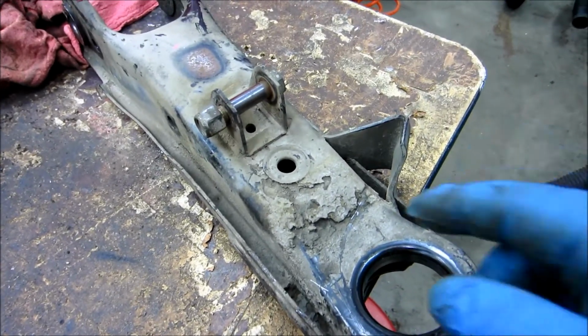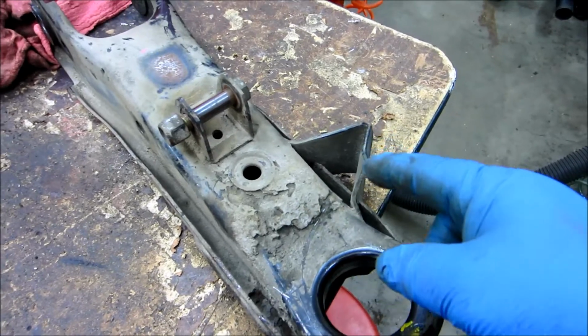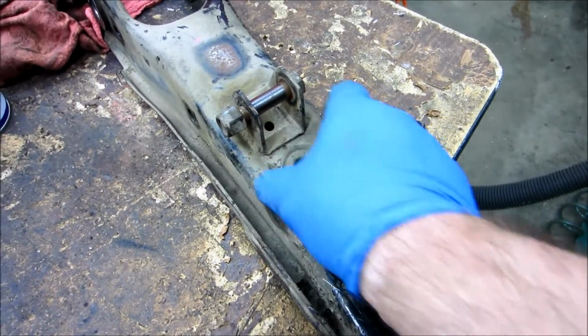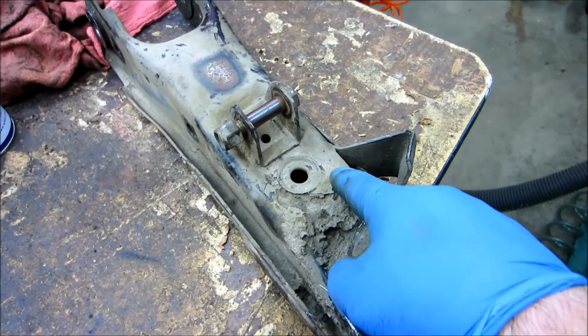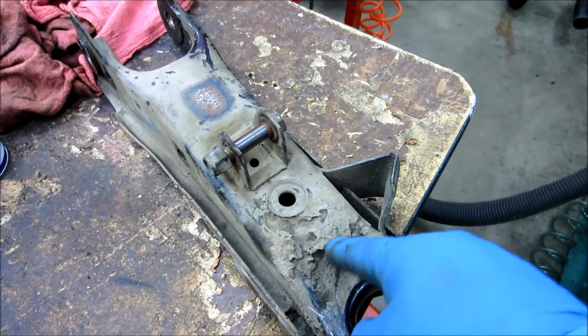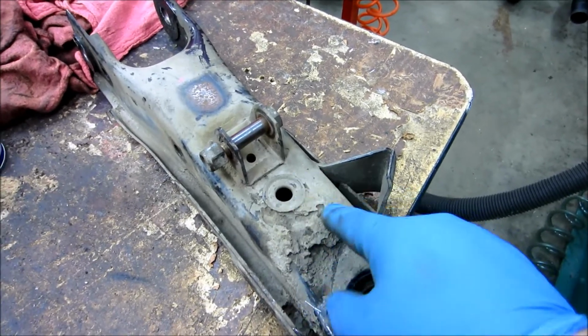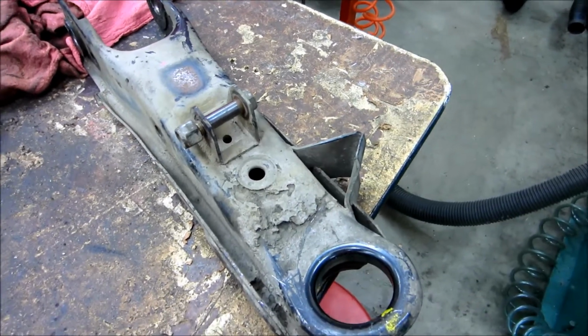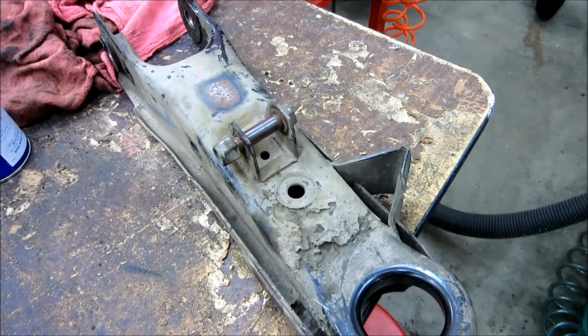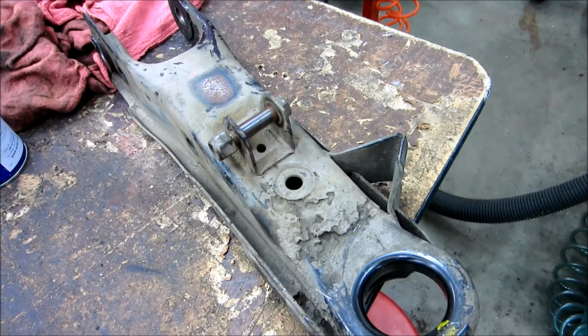And I might possibly, this arm is the opposite side and it's backwards. If I offset it, I'm on that plate. I could actually bring that plate down far enough forward and possibly use that as a nice mounting place for the sway bar mount. So it'll be a more expensive piece being that size, but just might be worthwhile.